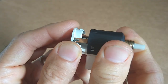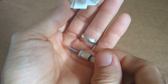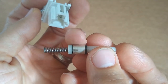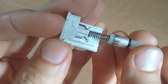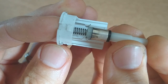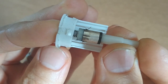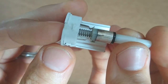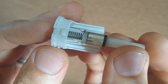This thing is so simple — be careful when you slide it out because there's a spring inside. All that's involved is a plastic pin with a copper contact around the edge — you can see the little copper contact spins freely. There's a spring that rides on a bar. How it works is: when you depress the switch, those two little contacts touch that copper ring. What's happened is there must be some residue built up on these little contact points. I'm going to solve the problem by giving it a light sand using some 600-grit wet sandpaper.